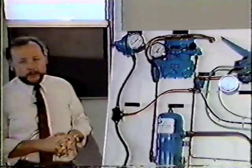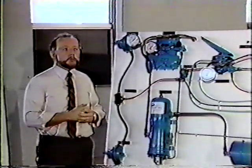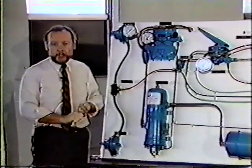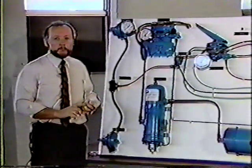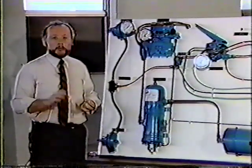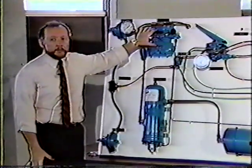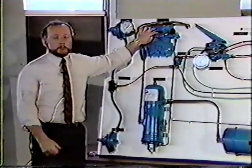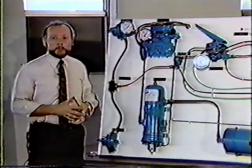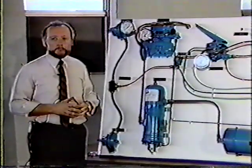If you take care of the quality of the air that goes into the compressor, you will get good long life out of the compressor. You obviously have to give it clean oil. That'll come from the engine. And we're going to cool it properly. You have to maintain the filtration. If you've got the strainer style, they would possibly need to be changed quite a bit more often than your air cleaner engine style or the style that's connected to the turbo.